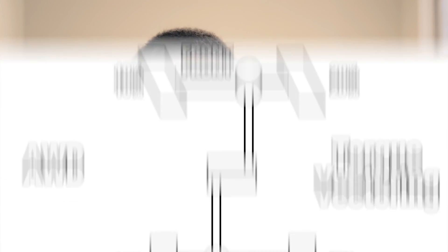This is why all-wheel drive cars are very popular in snowy areas like Flagstaff, Arizona. One of the cool things you can do with an all-wheel drive system is torque vectoring, which involves sending specific amounts of power to specific wheels to improve handling. This typically involves sending more power to the outside wheels during a corner, which helps the vehicle rotate better. It can also work the opposite way — if the vehicle detects that you are drifting, it can send more power to the inside wheels, or more specifically the inside front or rear wheel, to correct a slide. Torque vectoring can be found in high-performance cars such as the Nissan GTR, which is part of the reason it is so fast.